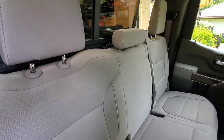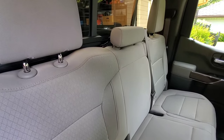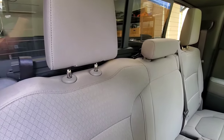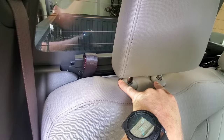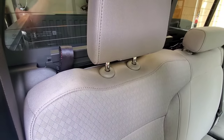I'll be removing the back seat from a 2020 GMC — it's the same process in a Silverado 2019 and newer. First thing you have to do is remove the headrest by pressing in on these two buttons, and the headrest just comes out. Once I get that out I'll show you the next step in the process.